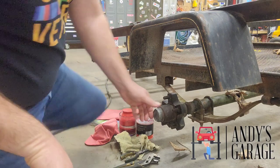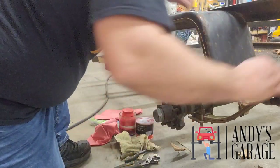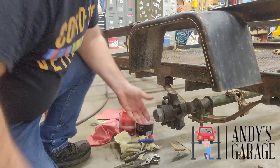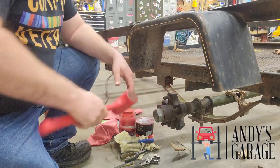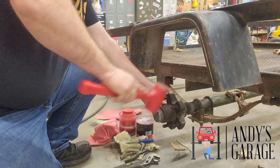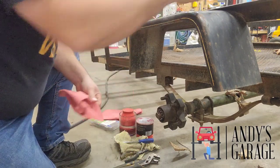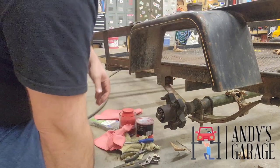To get started we're just going to take this dust cover off. You can use a standard screwdriver and try to get in between the cap and the hub — that's whatever you want to do. I like to just take light taps of a rubber mallet or a dead blow. You don't have to whack it real hard or you'll beat the crap out of the caps. They're pretty thin metal as it is, you don't need to be beating on them more than you need to.